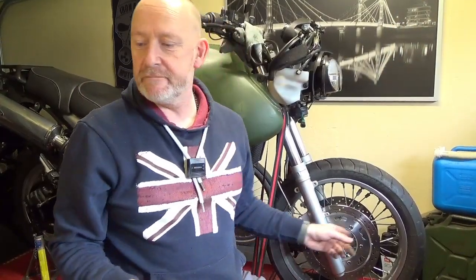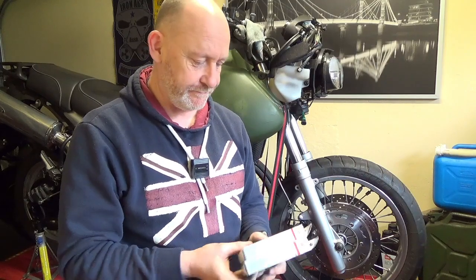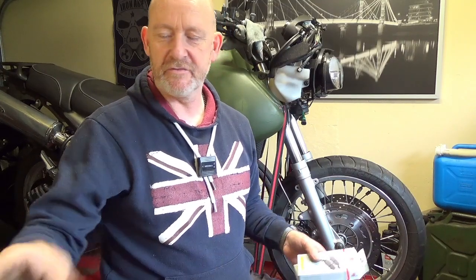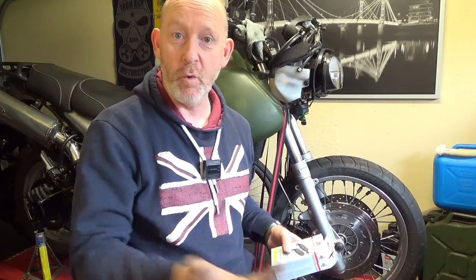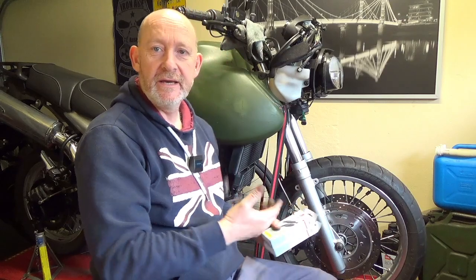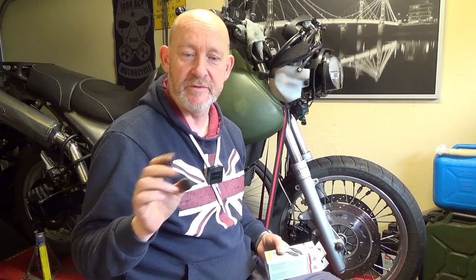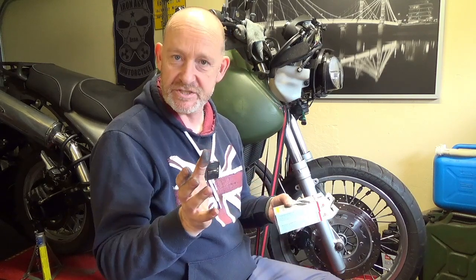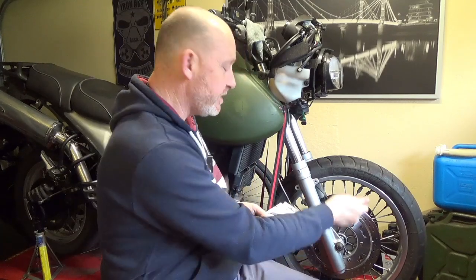Alright, so as I say, luckily enough, we have brake pads on this bike that are the same front and rear, so you can just get 3 sets of the same pads and change them all, and they're all the same system. Undo the 2 bolts, remove the dust cap, pull out the retaining pin with the Allen bolt, remove the caliper from the disc. Sometimes it will stick because of the lip. Just use a little nice rubber hammer or something just to knock it off.